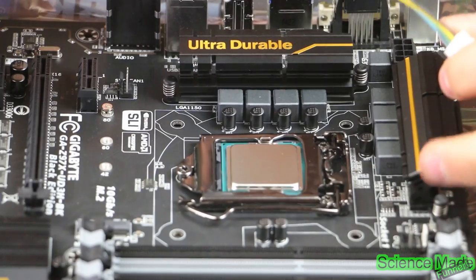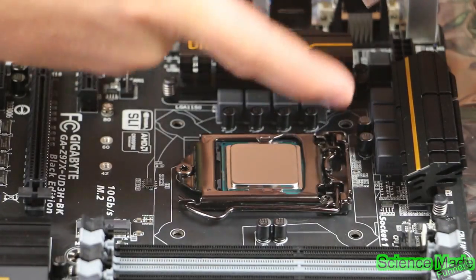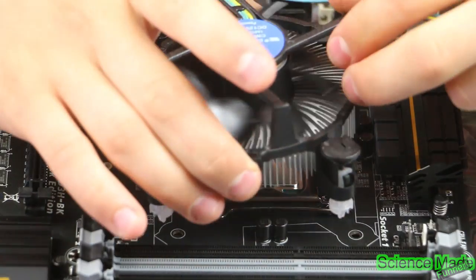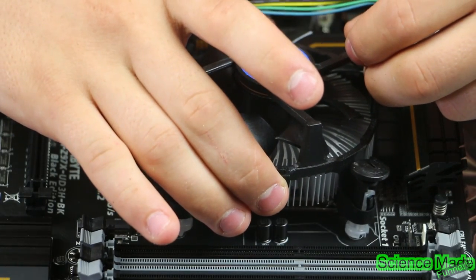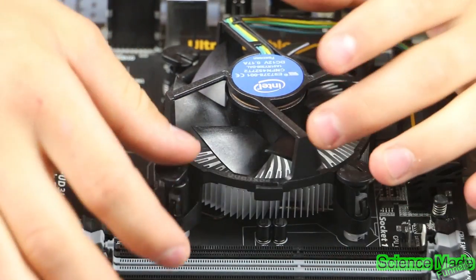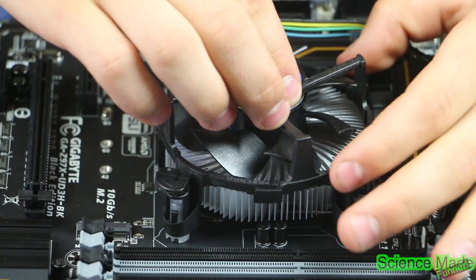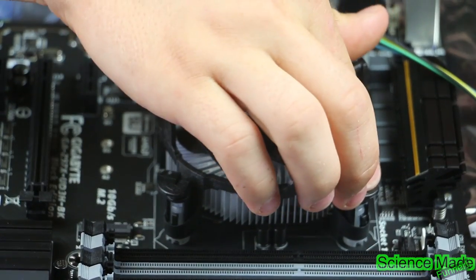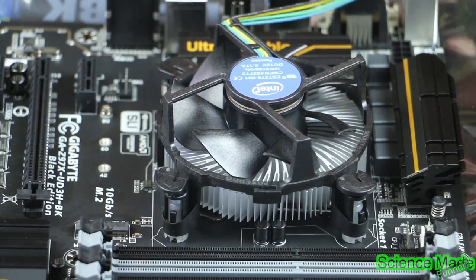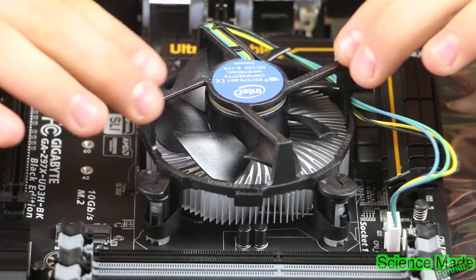You can read your motherboard to see where your CPU fan plugs in. Now I'm going to install the CPU cooler. Sometimes you have to apply CPU thermal grease, but this cooler already has grease applied to it, so we don't have to worry about that. Place it down, make sure the holes are lined up, press down and it should pop in. Next, plug it in. Your CPU is installed.